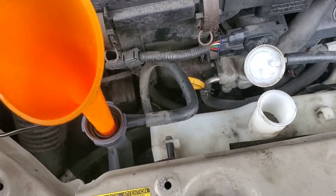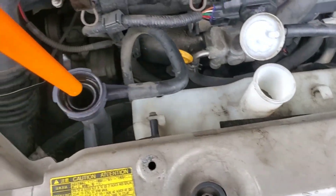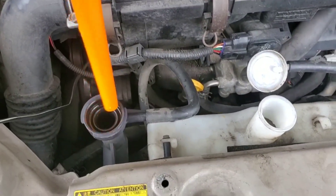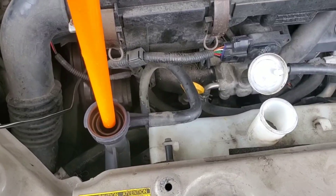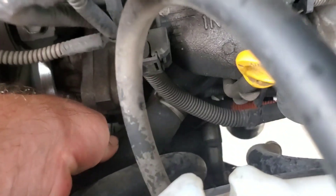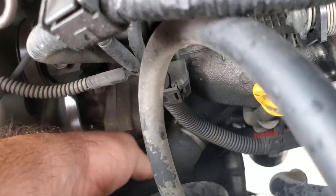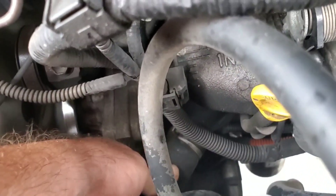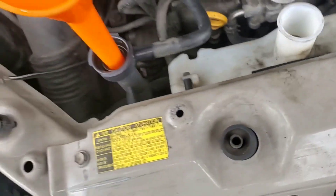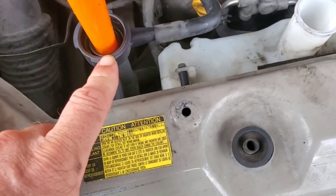For refilling, I ended up refilling the coolant overflow tank. I'd hold the funnel with one hand and fill with the other, and it would slowly trickle down. I'd also reach down and squeeze the hose with the car cold to try to force any air bubbles out.